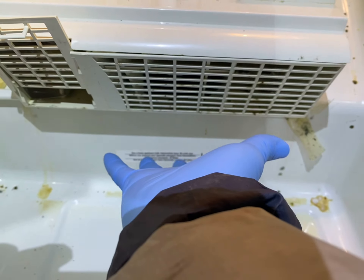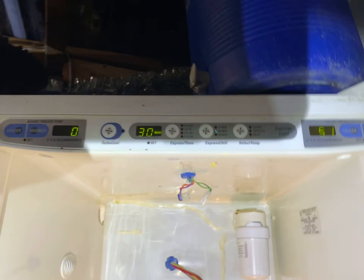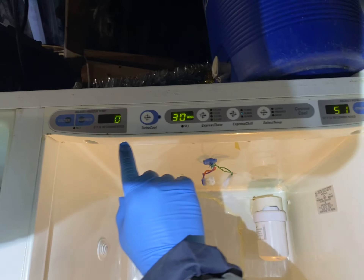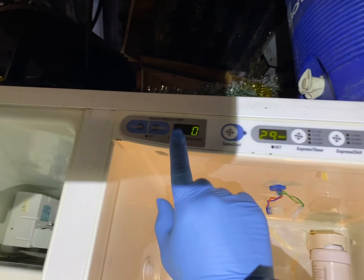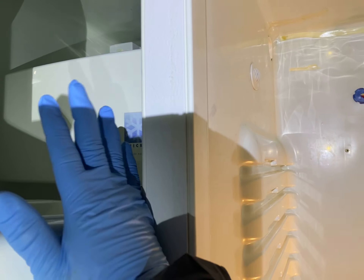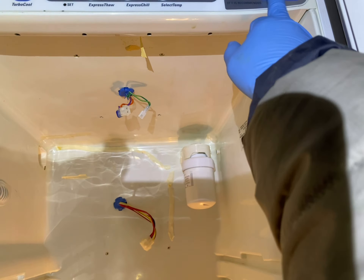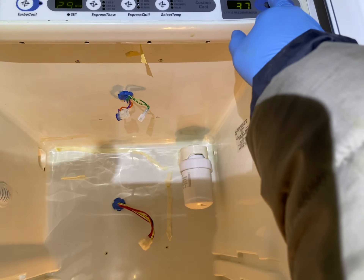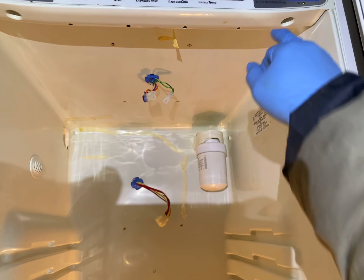They also said it came out warm over here. Today we hit this thing called the Express Chill and it's coming out very cold. Looking at the GE controls, this one says freezer temperature and this one says refrigerator temperature. The freezer is on the left side — that's where the ice cream is — and it says recommended to be zero, and it is zero. Over here it says recommended at 37, and we currently have it set at 52 because the whole thing is open, but we can make it 37.